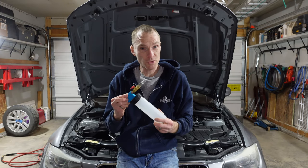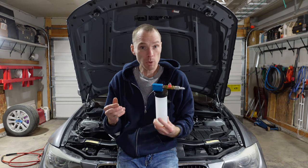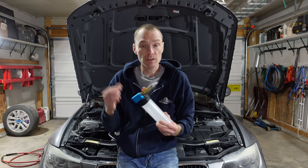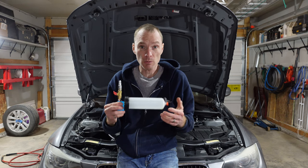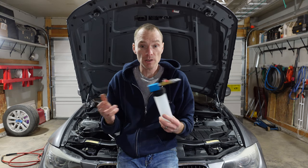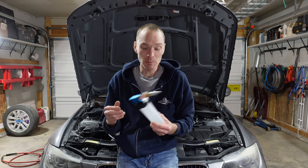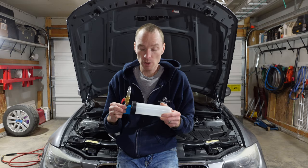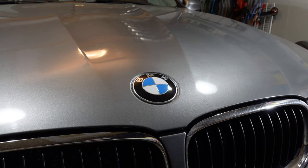Here's my bleed tool — this was my first time using it. It was just a cheapo unit off Amazon that seemed to have some decent reviews, and it worked not bad. You'll notice that after each caliper, except for the one where I had a plugged bleed valve, I did a manual pump just to make sure it was still coming out right. There was no air in the system, no bubbles, and it worked out pretty good. I'd rather probably pump the brakes manually, to be honest, just to be on the safe side. But if I didn't have a helper, I'd use it again — not a bad tool for the toolbox. Another job well done. Give me a thumbs up if you like that, and hit subscribe if you'd like to see more.